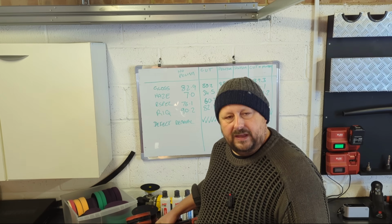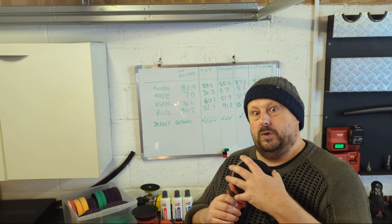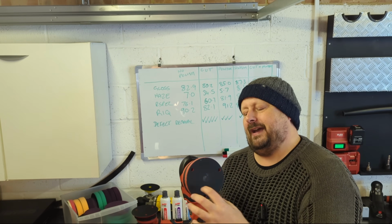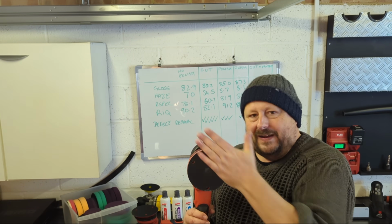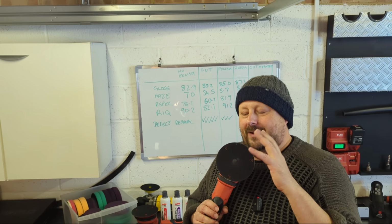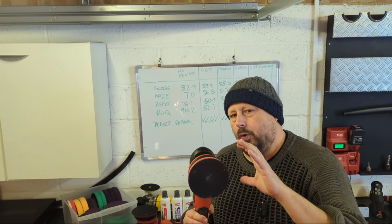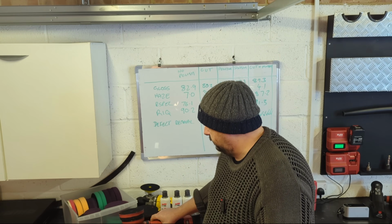And there is, of course, if you've been around detailing for a while, another form of dual action polisher, which is the forced rotation dual action polisher. It's very similar to this, except it runs around a track which creates drive to the rotation. So I can't spin this. So effectively this is going like this. I like this machine because you can't stall it out, and I find you can polish right up to the edges with it, and it's just great. But the disadvantage is, because it's driven, it can pull you a little bit more, but I don't find that much of a problem. I also really like cordless tools, I just do.